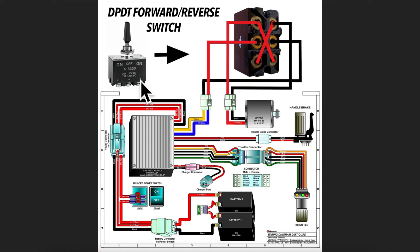We have a 24 volt system - do not use a 12 volt switch. You want to use a 24 volt switch or higher; you do not want to go lower as that can cause electrical failure. Same with the amps - you want 15 amps or more because the motor component uses a 15 amp wire. You can use an on-on switch which is just forward and reverse, or the on-off-on switch which adds a neutral. I'll post some switches in the description. The neutral can act as a safety margin if you have kids - they would have to switch it to forward or reverse rather than accidentally taking off.